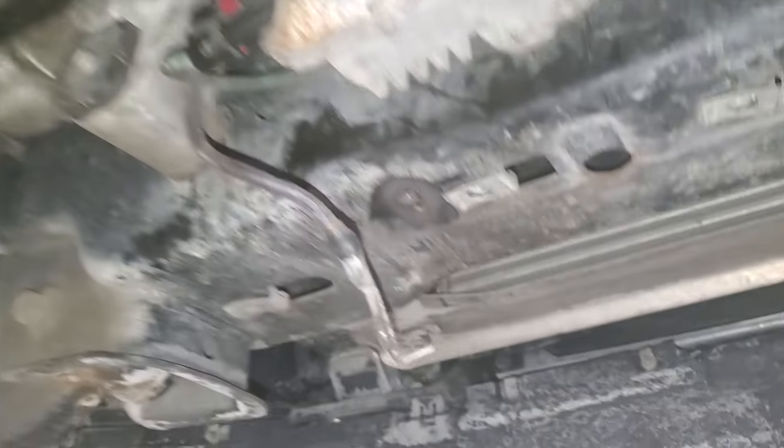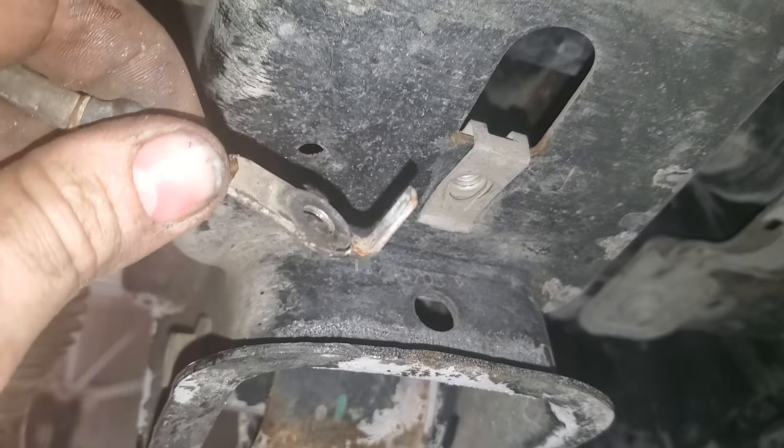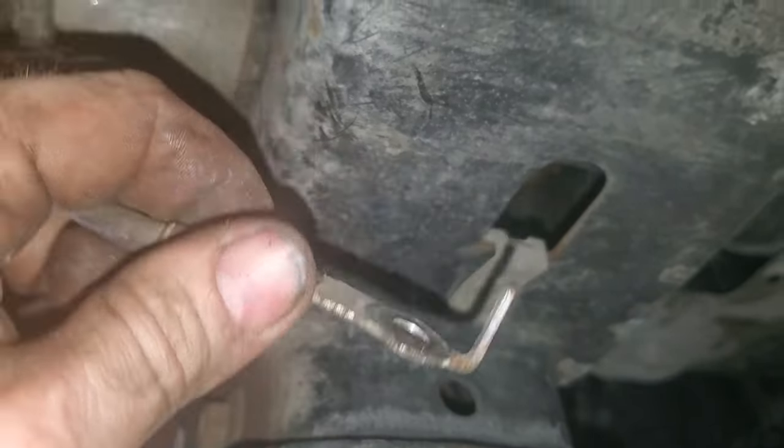Because you have an EPAS system — look at this, this is making almost no contact at all. This guy wonders why he's getting intermittent EPAS codes. I cleaned some of it up already but I'm going to continue cleaning it up.